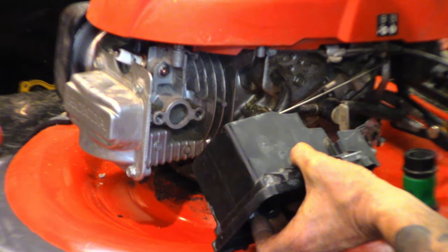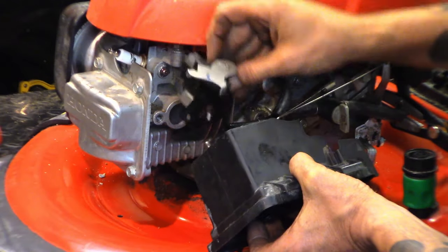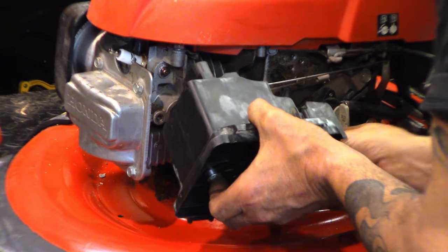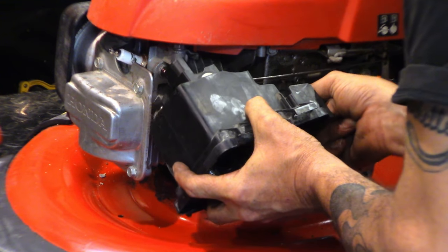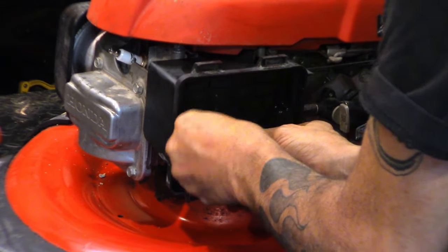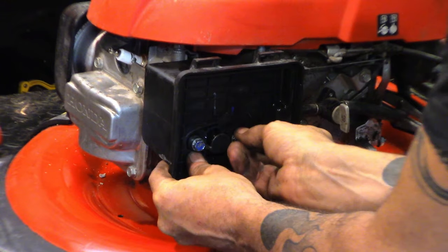and then there's a gasket between the carburetor and the choke assembly. Another gasket behind the choke assembly, and that'll go to the engine. I'm going to slip the fuel line on while I can. Yep. A little breather for the air box. Yep. Oh, our gasket fell off the back. And then we'll try and just wiggle everything all in there at the same time. Here we go. Wow. I think that went. That one's threading. And that one's threading.